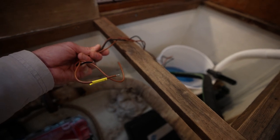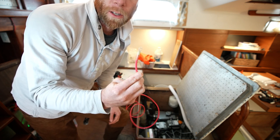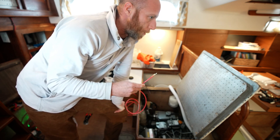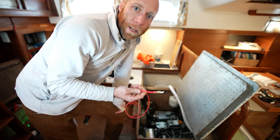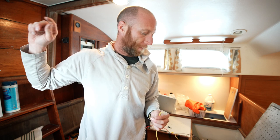I don't really want to jerry-rig this, so I've gone ahead and put in a 5-amp fuse, which is what the bilge pump calls for, into a fuse block. I'm rigging this up a little more properly since it is going to be running for an hour. I can keep the spare wires as my dedicated de-scaling electrical kit. That way, next time I can just wire this right back up and connect it to the fuse block. The benefit of putting it on the fuse block is that it's switched at the panel, so I can control turning this pump on and off at the DC panel.